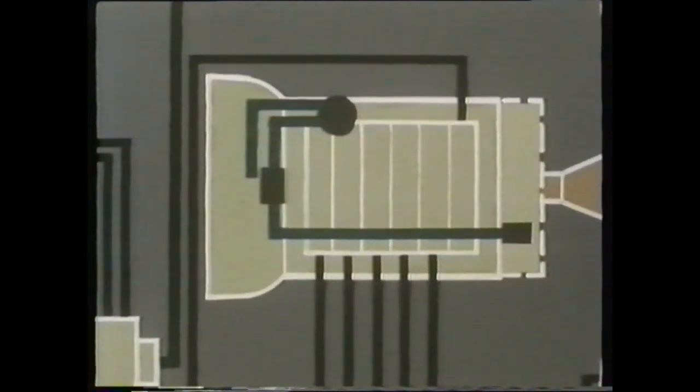A Leyland National, for example, has a close-coupled gearbox with a charge flywheel. That means that oil is pumped through this pipe system from the gearbox to charge the flywheel with oil. The Leyland Atlantean also has a close-coupled gearbox with a charge flywheel. However, since the engine of the Atlantean is mounted transversely at the rear of the vehicle and has an angled drive, the oil to charge the flywheel is drawn from and returned to the angled drive after lubricating the gearbox.